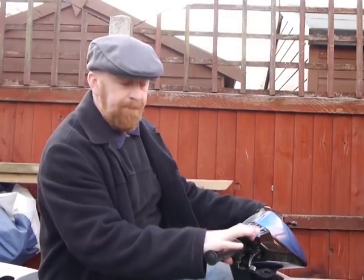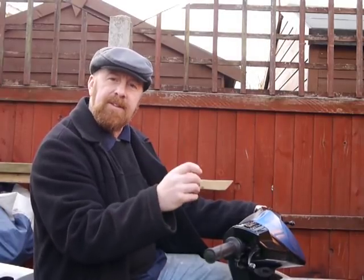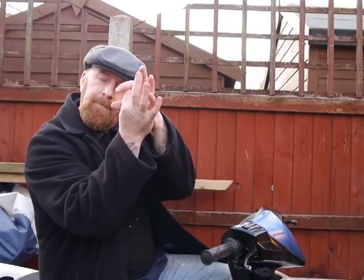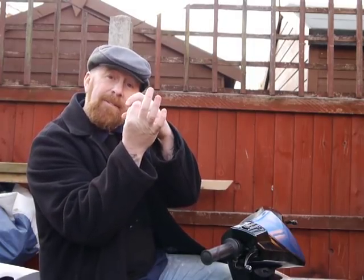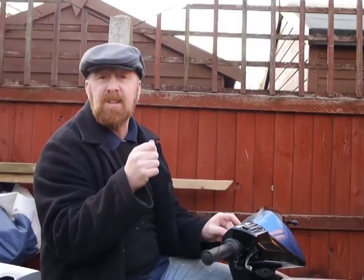So what have I got to do to this little bike? Front brake - really stiff. I'm going to take that all apart, clean it up, put it back together again. Speedo drive - take that off, which means the front wheel has to come off. I've had it before where there's a round circle with two clips on it, and they spin round at the same time as the wheel and can fray out. So before I'm buying a new one, I'm going to check it out first. When buying parts, check that it's actually broken first - otherwise you could buy another speedo drive, another cable, and it turns out that's not it. That's why I took the cable out, spun it round, and I could see the speedo was working here, so I knew it was something else.